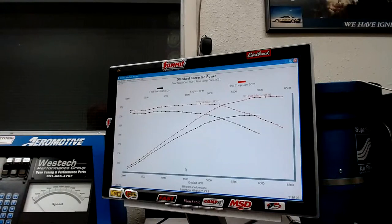So we have a lot of things that can affect the detonation threshold, and that's one of the reasons why, when I get a lot of these comments about dynamic compression, obviously I understand it and know what it does. I'd have to test like 100 or 200 vehicles out on the street that were similar where we could change only that. The problem is it's hard to change only that. As you see, when we change that, sometimes other things happen.